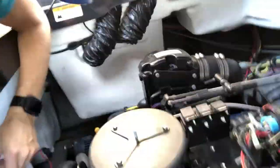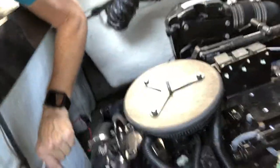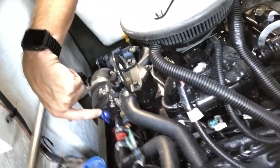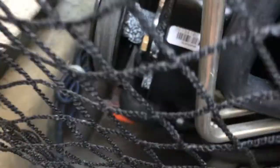Because this doesn't have an inboard cooling system — it's not a closed system, it pulls fresh water in from the lake or ocean — you should drain the water out. We're going to take this off; they're all labeled blue, which is really nice. We'll loosen this one off, and there's one more hidden down at the bottom — we need to get that one too. From inside at the bottom, we loosen this blue drain. You can see it's flowing pink — that's good, that means we got the system filled up. I take all of these out and put them somewhere I won't forget to reinstall them in spring.